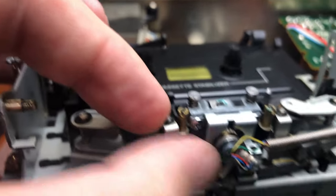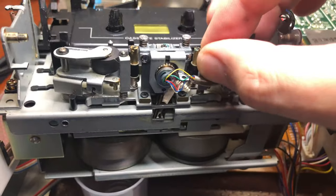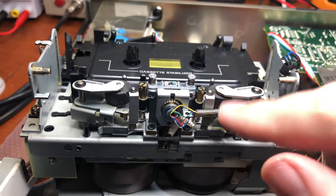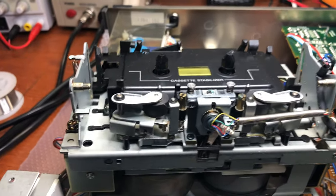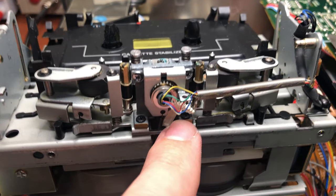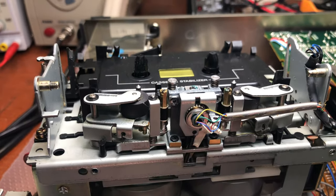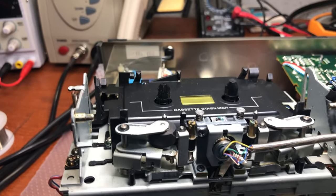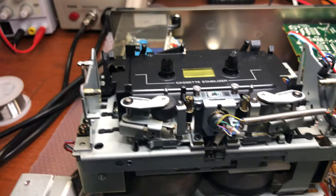Okay, so what I realized is it was true — I can't even move it by hand. Usually it should be quite flexible and move by hand easily, both of these guides. But that's not the case. This is what happened with the older deck. I'll need to disassemble, oil, and reassemble on this deck. These two guides on their shrouds are just stuck and don't allow everything to move freely. That's why the head rotation plastic piece can't rotate the head fully — same problem as the previous deck.